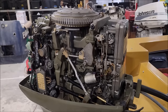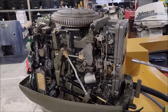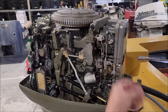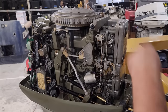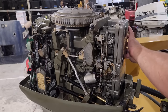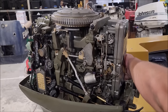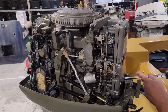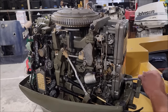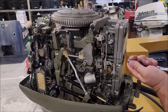The next step is fuel. There's a very good chance these carburetors have never been off, never been cleaned. So there's a very good chance it's just dirty carburetors — maybe an idle jet, maybe a main jet. Probably not the main jet since we never got to that point; probably an idle circuit issue. It has a fixed low-speed jet, so I can't just pop off the covers and adjust it.